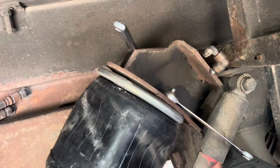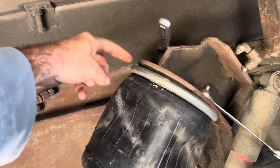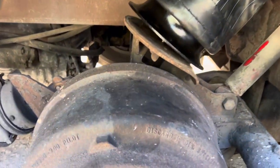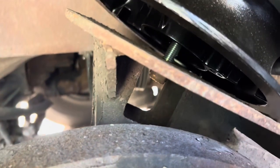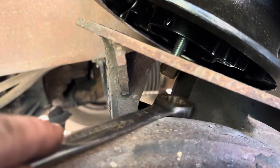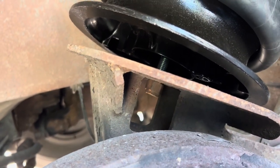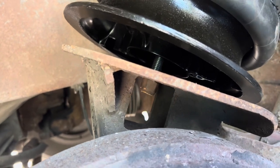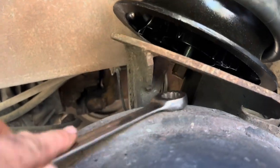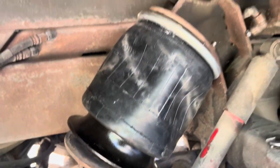To tighten the nuts back up we're just using a three-quarter inch ratchet wrench, and we have an inch-and-a-sixteenth socket for the nut for the airline fitting. The reason I use the ratchet wrench is that on the bottom one, the only place you have access is right through this little hole. It's hard to get a regular open-end or box wrench on it, and you really can't get a socket and regular ratchet up there. The ratchet wrench works great — you can just reach through the opening and zip it right off.